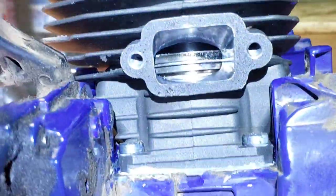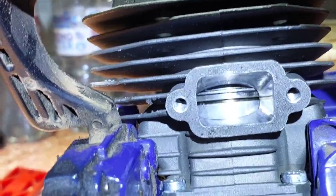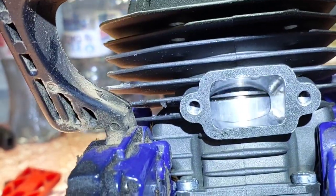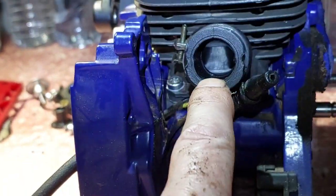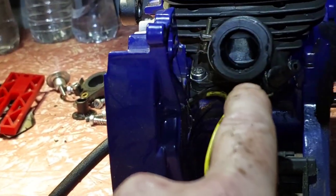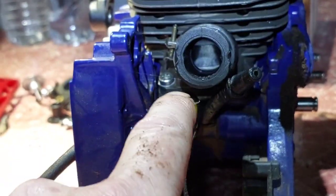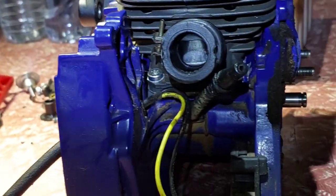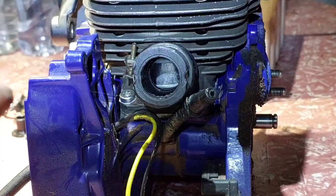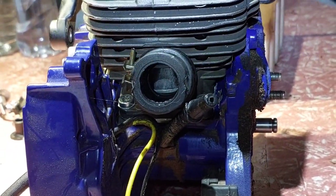There's a ring — it's going to be a different little saw. The top of the exhaust is more curved, so she should rev her head off. Really beautiful torque saw. But I haven't changed the timing much. I've made the transfer a lot bigger, so it's all about getting more air down there, squishing the sump more than usual, and just seeing how it goes. I've never really done it this way — it's different. I normally do a lot more timing, but I want more pressure in the sump to create more power. Well, that's the theory. Are we doing the timing on chainsaws the right way, or is this the right way? I'm not sure — let's just see how this thing runs.